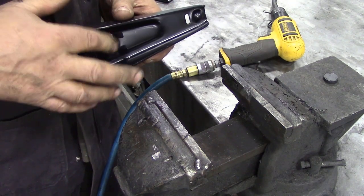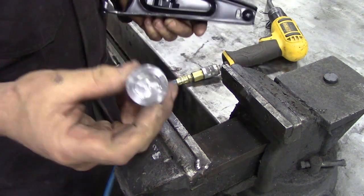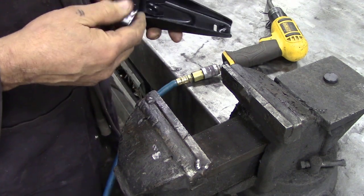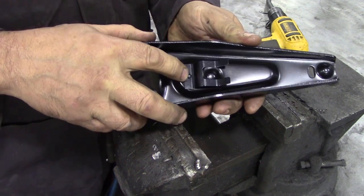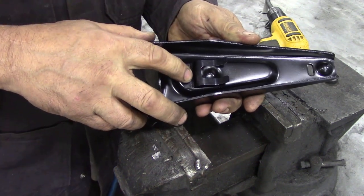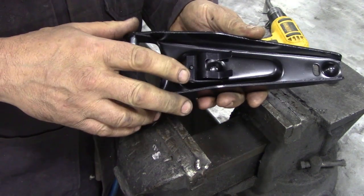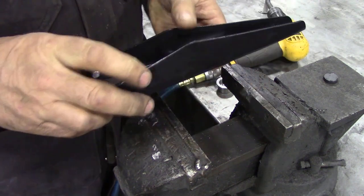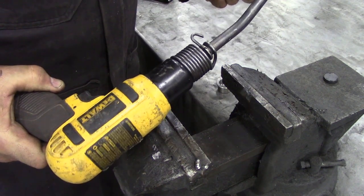In this video I'm going to do a little update on how to install your clutch bush. If you bought them in a kit, you might be wondering how you fit them. The first thing we've got to do is knock out this little rivet. You can do it in several different ways — you could center punch it, drill it out — it doesn't really matter. But don't damage the clip because we're going to use that again. I prefer to use an air chisel.